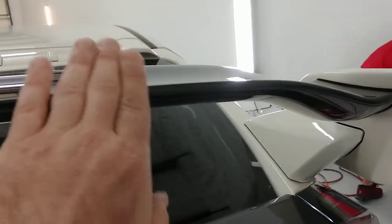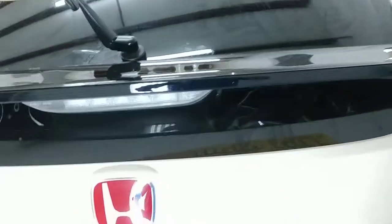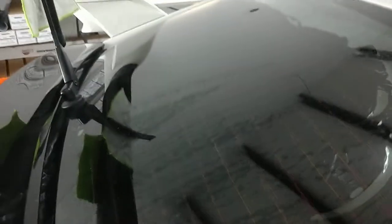This is not the spoiler that gives the problem — it's actually this one, because the film won't come down through here and it's very curved right here. A lot of people will go through a lot of work to get that spoiler off. We don't. What we do is we shrink it on the outside and put the film on top of the spoiler, then transfer it to the inside.